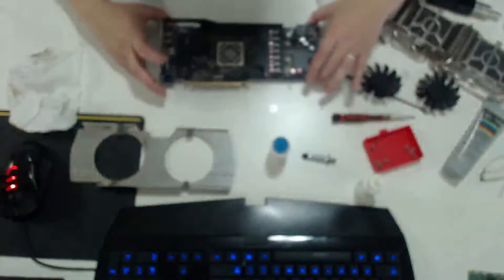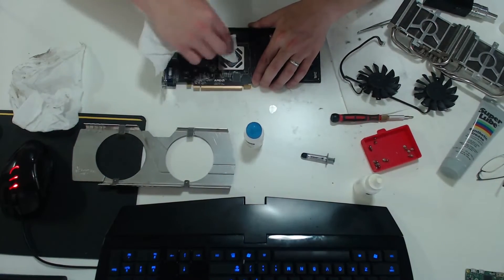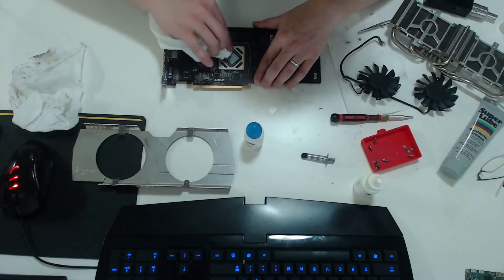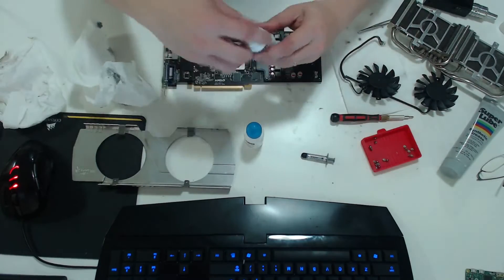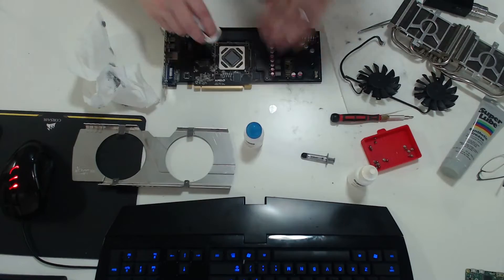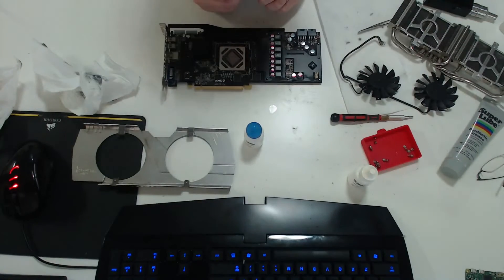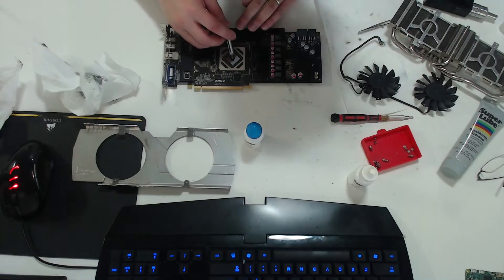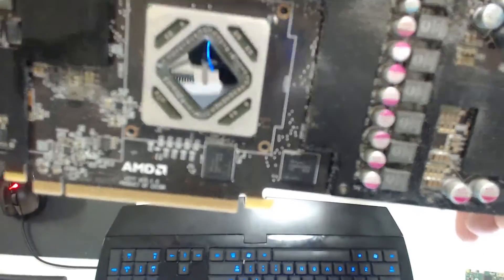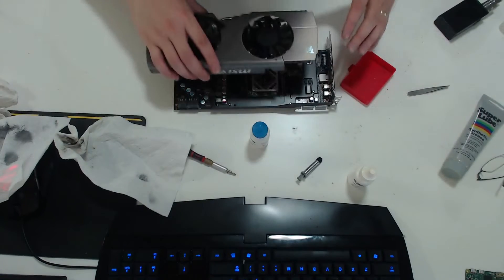Make sure it's dry before you apply the thermal paste. I'm also using Arctic Silver thermal paste — I'll leave a link in the description, and like I said it comes in a kit. When applying thermal paste, you don't have to apply a lot — all you really need is a grain of rice. The whole purpose of thermal paste is to help transfer heat through the cracks and imperfections of the chip. It looks flat, but there are little imperfections on both the chip and the heatsink — that's where the thermal paste fills in the gaps. Too much thermal paste will actually harm it, which is why I say use just a little grain of rice.